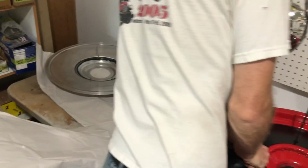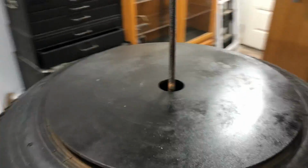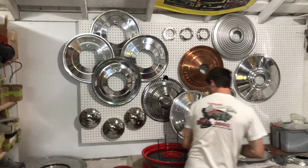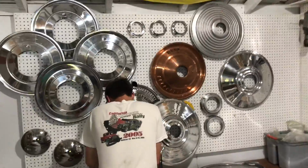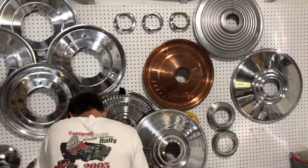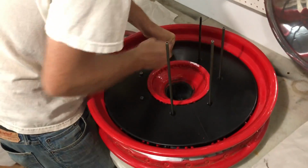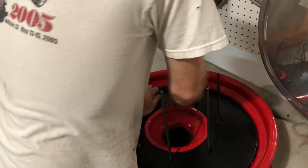Now, as Matt continues with that, just to show you briefly, this silly looking spare tire here is a press that we've used with a variety of different intersecting features or jigs that allow us to change the shape of the wheel covers so that they conform to the offset of the hub between the rim and the hub. All wheels are laced slightly differently. Hopefully all of your wheels are laced the same because, of course, these are quite specific to this wheel.